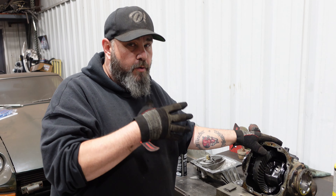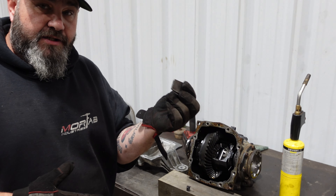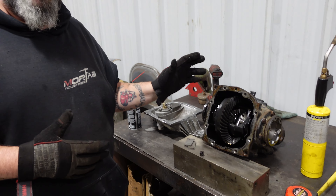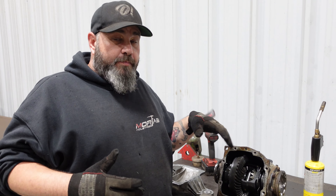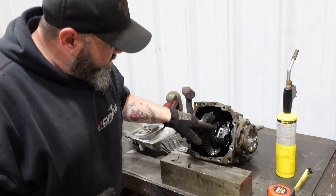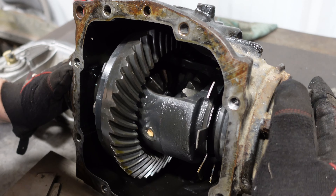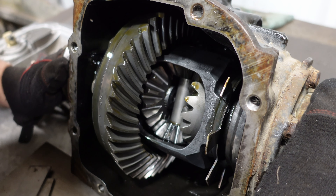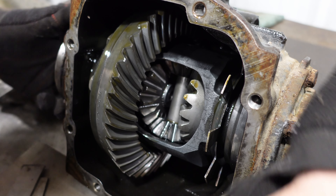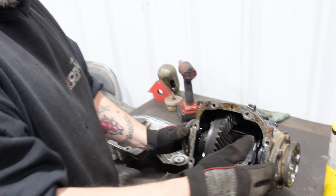We're going to show you exactly how we're welding this diff, what we're doing to mitigate the splatter, as well as these little plates that I weld in on these diffs and why we weld the plates in. We're also going to show what we do when there's a C-clip axle, because that is the number one question. If you look very closely at this diff — this side doesn't have the clips — but if we rotate it over, there's another open side. So the simple answer is: if you've got a C-clip axle, you only weld a plate on one side, and the other side stays open so you can get your C-clips out.